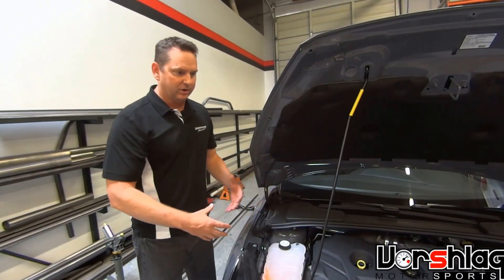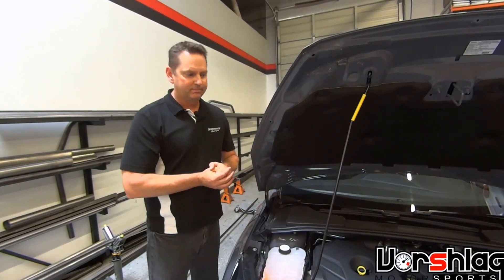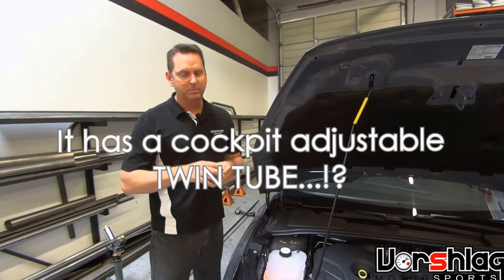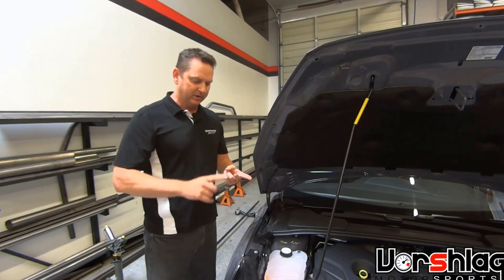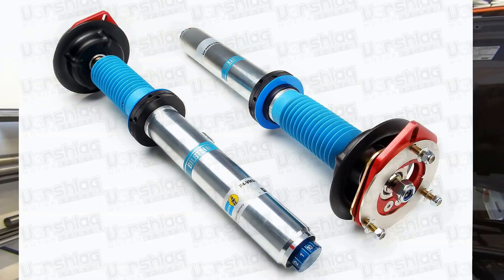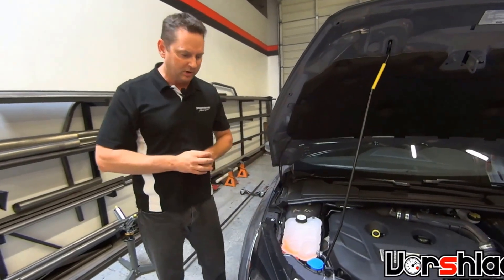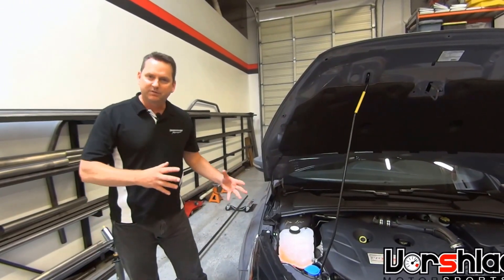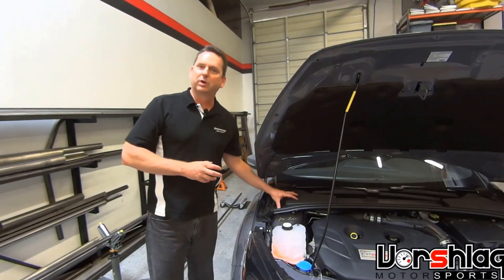People think the factory shocks on a new car are magic — most of the time they're garbage. These shocks are nothing special; they have some little doodad on them, a 'sport mode,' that doesn't mean anything. We can work with a coilover: 60 millimeter, two and a quarter, two and a half inch ID spring with a real shock — it can make a big difference on these cars. And I guarantee you they're really, really soft like all OEM cars are, yet it still rides pretty harsh. There are some things we can fix, but we can't do the easy camber plate that everyone's going to want.